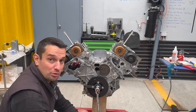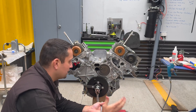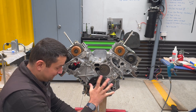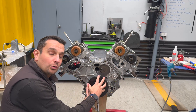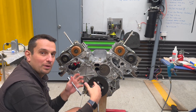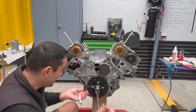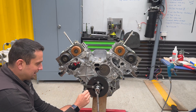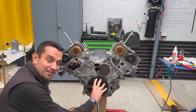The timing kit basically comes with three tools. One of them is to lock the crankshaft, and this is the most important thing. I've seen people trying to do the alignment procedure without actually locking the crank — that makes no sense. Timing the engine is nothing but synchronizing all the cams to the crankshaft, so the pistons going up and down don't hit the valves being pressed down. For that, we have this special tool fitted to the crank and locked in place — this is what BMW sets at 150 degrees before top dead center on cylinder one.